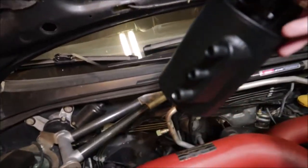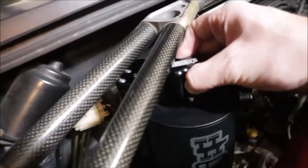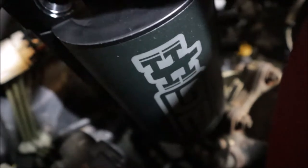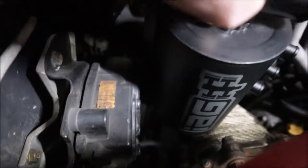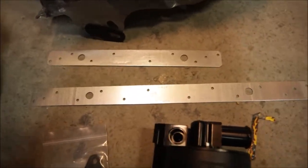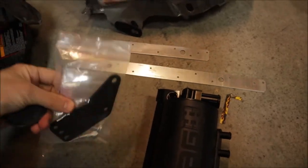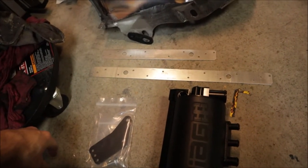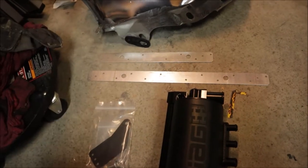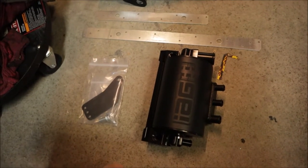Let's try option two — back here. Is that gonna work? We're gonna have to custom fabricate a mount. How close is it to the turbo? A little close down there. There is a black piece of plastic that probably needs to stay. We went to the hardware store and got some metal straps. It's pretty thin. We're gonna use the mount that came with it. I might just use these to mock up a bracket and then go back and get some thicker gauge stuff, but until we get it bent and in the right spot we'll see what mounting locations we have.